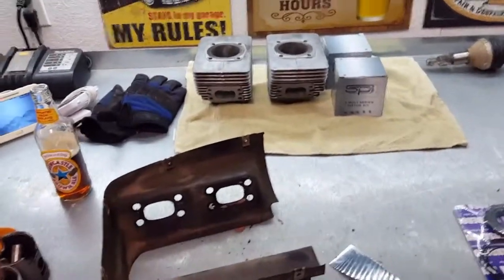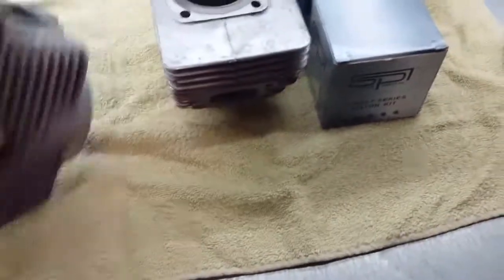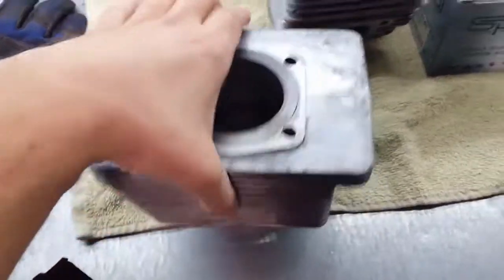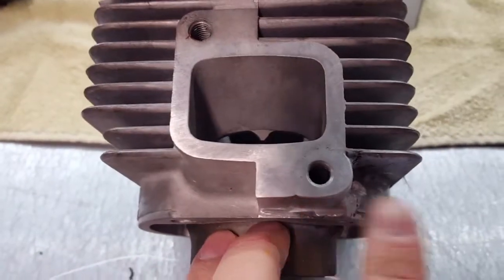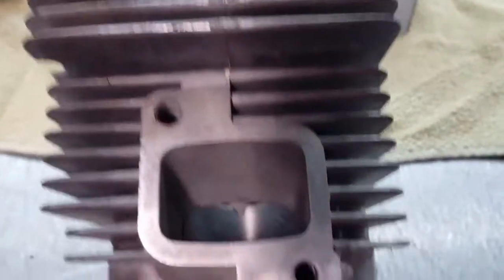It's been a long time but I finally got some work done on these cylinders for the Citation. I took them in, got a bore and honed out 20 thou, and that's what it took to get them all cleaned up. This one here was all JB weld, so I took it all out, faced it off, re-drilled and tapped it — that's all good to go now.